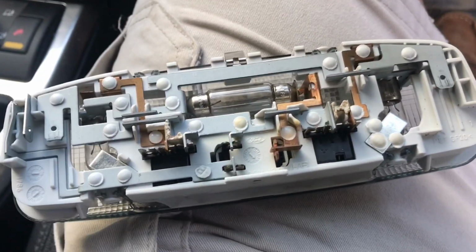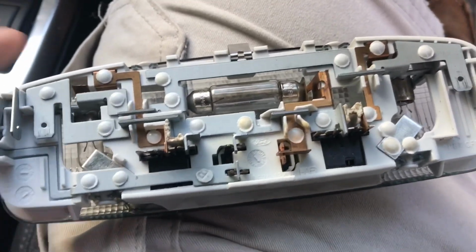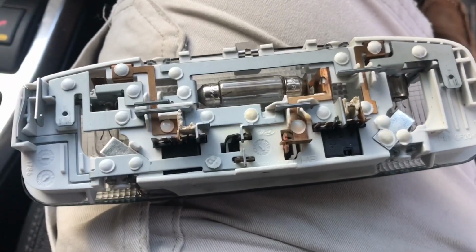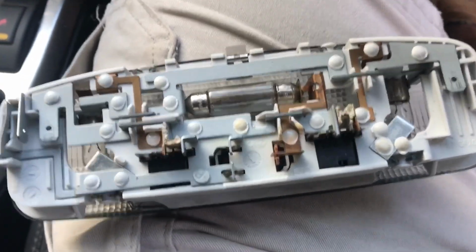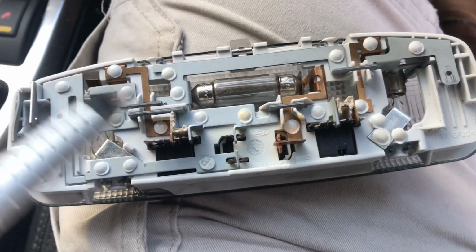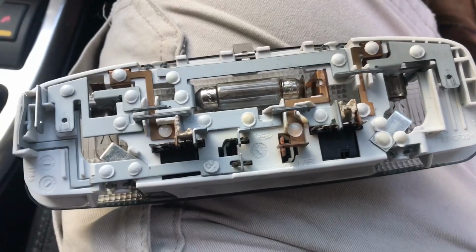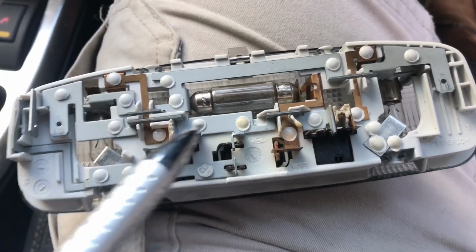This explains why yesterday when I was having a look at this, I couldn't get the little LED bulbs in the lights to work. However, when I took them inside and put a 9 volt battery on them, the little lights lit up fine. That's because they're LEDs and I had my 12 volts backwards. LEDs only light in one direction.